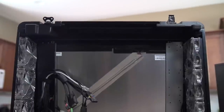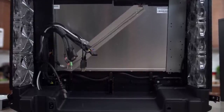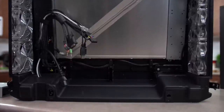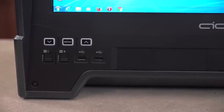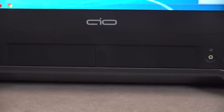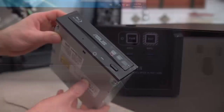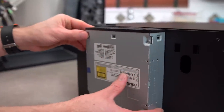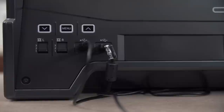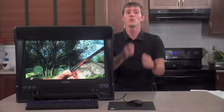Taking the Drone Station apart reveals all the interior wiring that passes through from the inside computer to the front or rear of the outer shell. Ethernet and a single power connector that handles both the monitor and the PC come out the back. The front has two USB 2.0 ports, two fan controllers, monitor controls, headphone and microphone jacks, two USB 3.0 ports, and then power and reset switches, topped off with a couple of 5.25-inch bays. The fan controllers let you run the left and right side fans at one-third, two-thirds, or full speed, controlled independently.